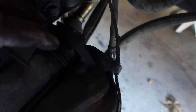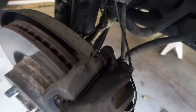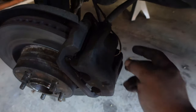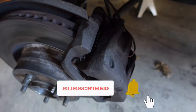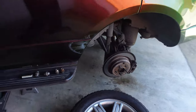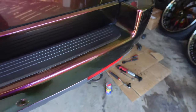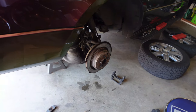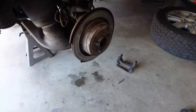You also need a wrench - the wrench hole goes here, the 13 goes there. Once you get the caliper out of the way then it's easy to see the bracket bolts. This sensor really just kind of pulls out - it's new so it's kind of in there tight, I might need some needle nose to pull it out, but do not break it. It's a 15-dollar fix if you force it out. They say replace it anytime you replace the brakes anyway, but if you catch your brakes before they're all the way worn you don't have to. My brake pads were maybe half worn - I still had a lot of life left but they're under a lifetime warranty, so why not replace them now that I'm replacing the rotors.